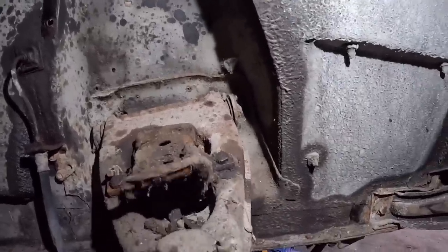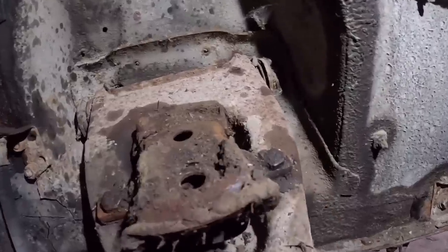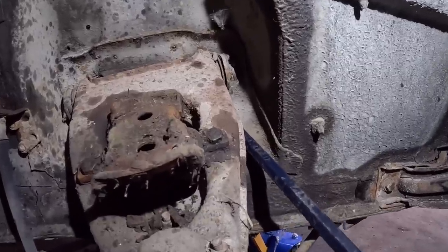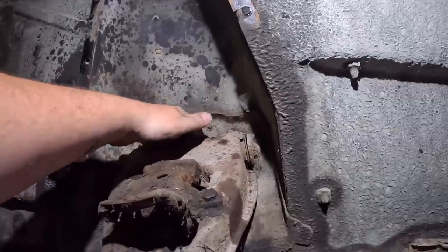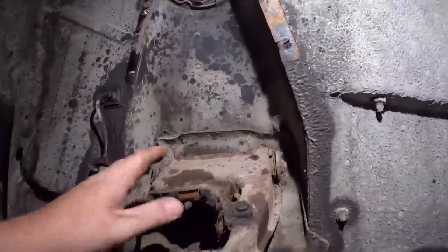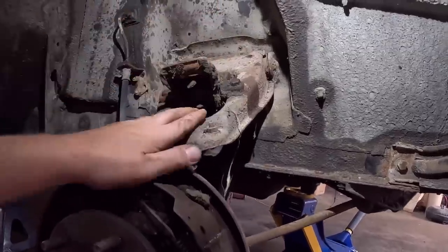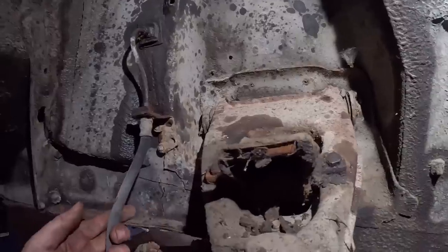you can see how much unhappiness there is. I'm gonna get my bar here and this front control arm has a bunch of junky play in it, so we'll take that out. I believe there's just a couple of bolts that go through, so I'll probably break this upper control arm up. That'll then just leave everything down here. We can change that, put it back in, bolt it down, take the lower out, and repeat the process on the other side. Fairly simple.